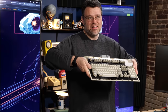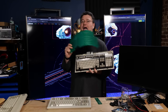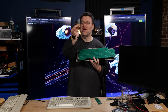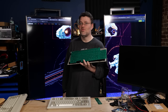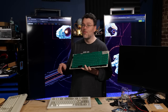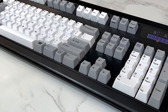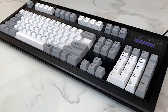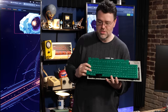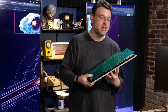This is technically a membrane keyboard. It's only got 2 key rollover. And unless you replace the membrane with a printed circuit board and replace the flappers with capacitive flappers instead of resistive flappers to do your M to F conversion. Wait, M to F conversion? Oh, that's coming up. I've been working on that for a while. This is designed to drop in the Unicomp variants of Model M and restore capacitive switch functionality. This is pretty much the only mod that you have to do, to just swap out some printed circuit board stuff with some other stuff. And so I understand obsession with old keyboards, but that's not about this. This is about beam spring keyboards, not the Model M.